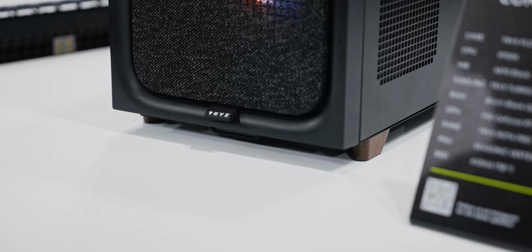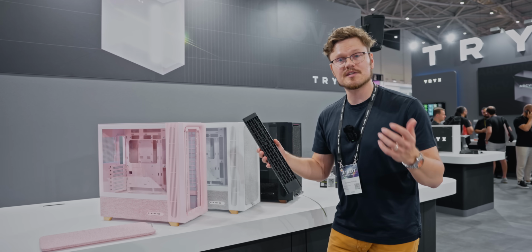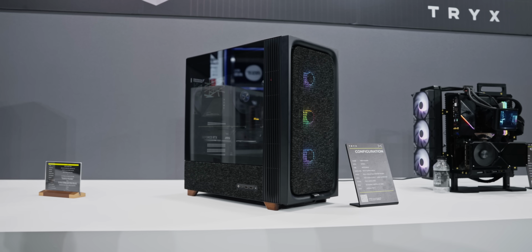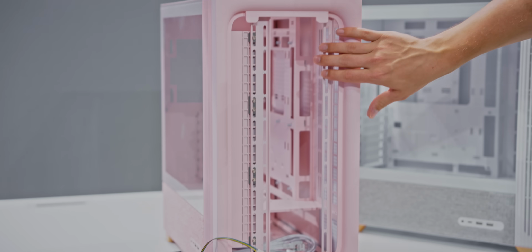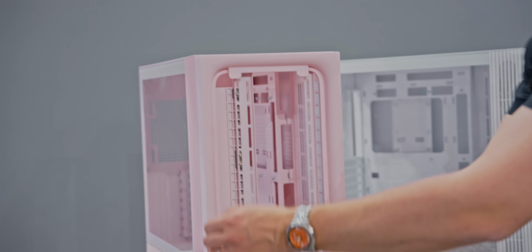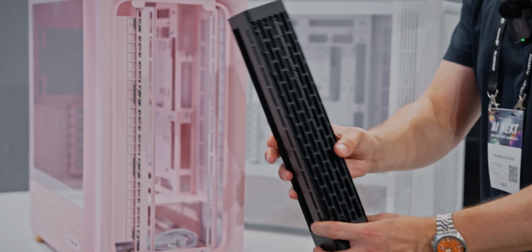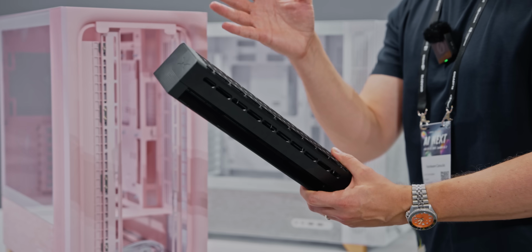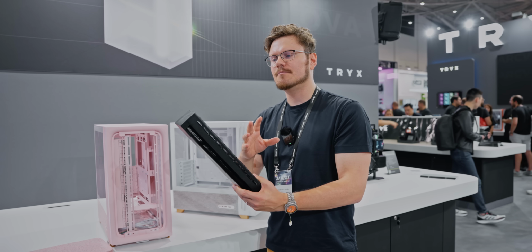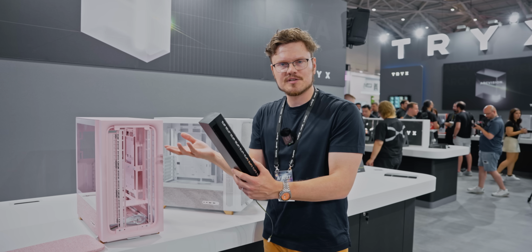It looks really good, but the compromise is not very breathable like we've seen, for example, with Fractal Design enclosures in the past. So we can still do 140s and 120s with these fan brackets that you can maneuver to give you a little bit of flexibility for your front installation. And this fan is just going to be mounted with a standard 4-pin, so you don't have to worry about anything specific. It will spin at around 2500 RPM. It will produce an equivalent of airflow between 120 to 240 millimeter ventilation setup.